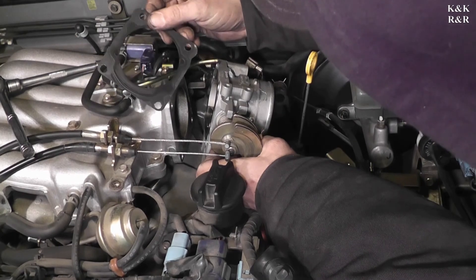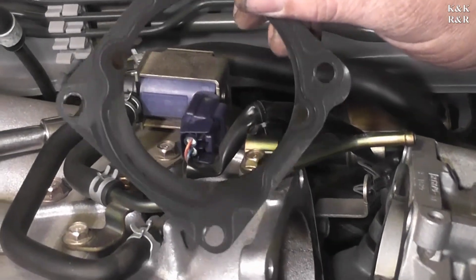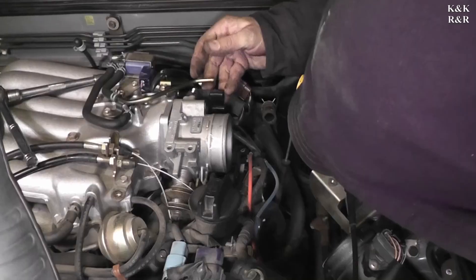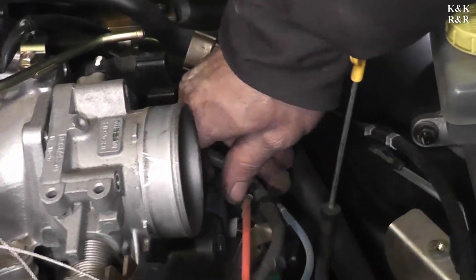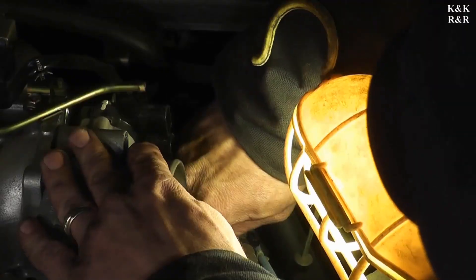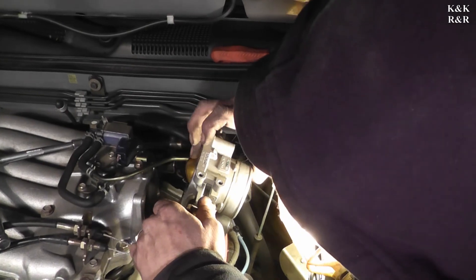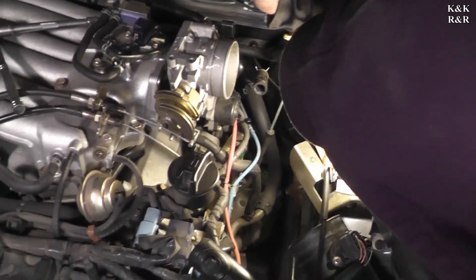I'm going to take our gasket off because it looks okay. This looks like a piece of metal, so that is definitely a reusable gasket — we'll clean it up and reuse it. One more wire I'm going to disconnect is the idle air control motor on this. It should be enough to wiggle it. What I might actually do is open up the throttle plates and — voila, we got room. Not much, but sometimes that's all you get.